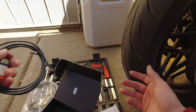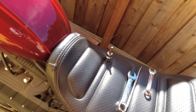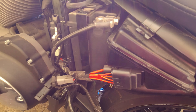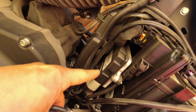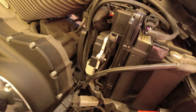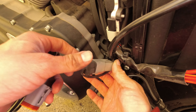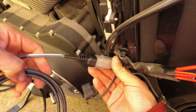That's pretty much it — pretty straightforward. Let's go ahead and go over here to the battery side, which I already removed the cover on. If you're wondering where the ECU/ECM is, it's right over here. Depending on the model, it might be in a different spot, but on most models — 2007 and up — it's right underneath the seat. You're looking for this connector right here. Remove the little boot and then you connect the device right in here, and that's pretty much it.